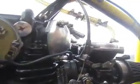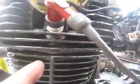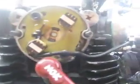A big oil leak coming out of here. I'm trying to get in there to see where it's coming from. And I can see a drip from the rocker, from the tappet cover. Okay, if it's from there, I'm happy. I can seal that up. If it's from the cylinder head, I'm very unhappy. Well, it can't be because the cylinder head gasket's there. The rocker cover gasket is here, and there is a definite drip above that level.